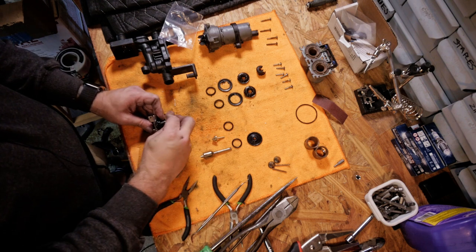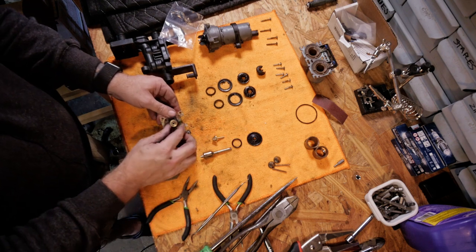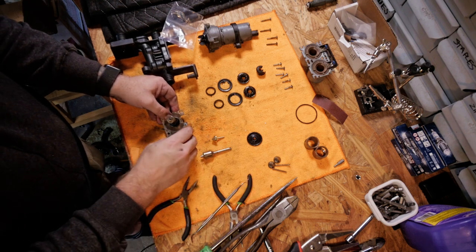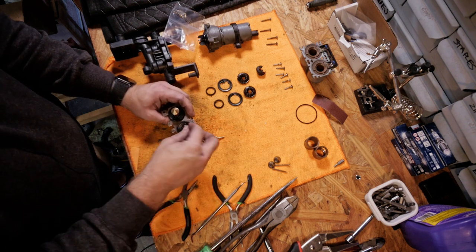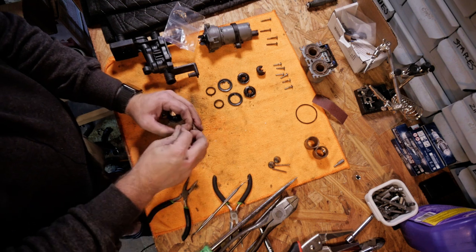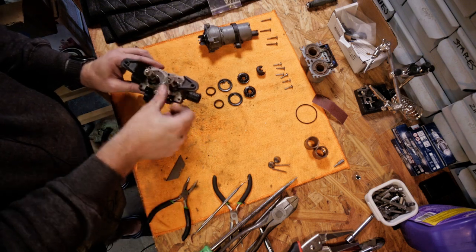Before putting the plungers back in, replace the cones on the ends. I found it easiest to use thick pliers with just enough room for a screwdriver to twist and break the cones loose. On mine they were so badly corroded that the heads just snapped off the post, so replace them. The surfaces of the plates had a bunch of residue from the old gaskets, so I used fine sandpaper and razor blades to clean mine off before putting the new gaskets on. Then reassemble all the new parts — the plates are indexed to the bracket so they can only go back one way, and the solenoids are also indexed.